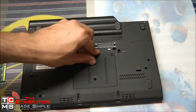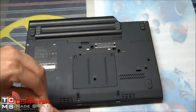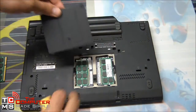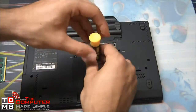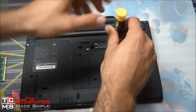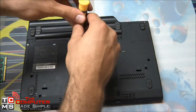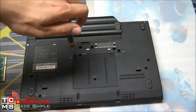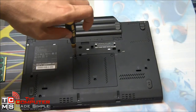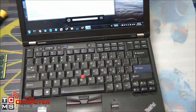On this particular model only a small section of the back can be removed to access the RAM modules. Some other computers will have much larger panels, but they are usually identified so you can upgrade the RAM or the hard drive — usually the two items you can upgrade yourself on a laptop without completely tearing it apart. When tightening the screws back in, as soon as you feel resistance and it's snug, that's tight enough — you don't want to strip the screws and risk not being able to open it again. Thanks for watching guys, I'll see you next time.